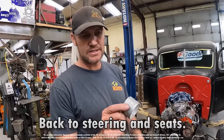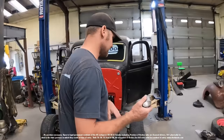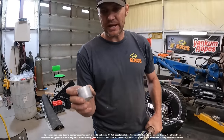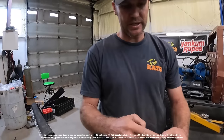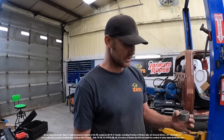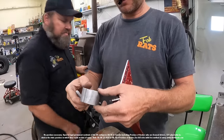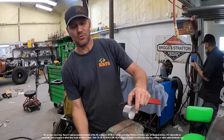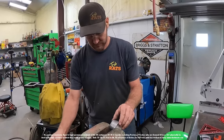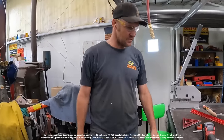We've got a piece of exhaust tubing that's the right size to fit over our steering column — pretty snug but it fits. The game plan: I'm going to cut this directly in half on this side and half on that side, make two brackets so it bolts back together. Weld one half inside and then the other half I'll drill through and pin. Right now you're an artist. We'll cut that and then start welding — clean those up, weld some tabs on them.